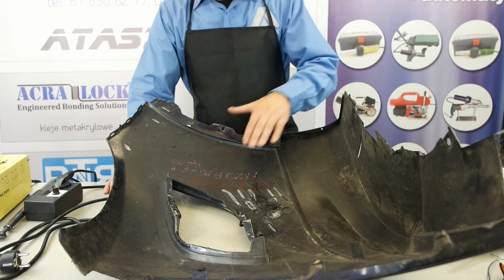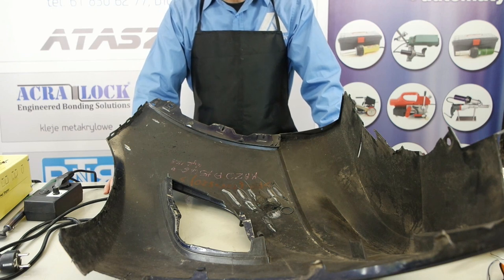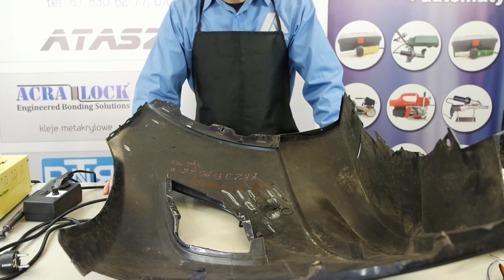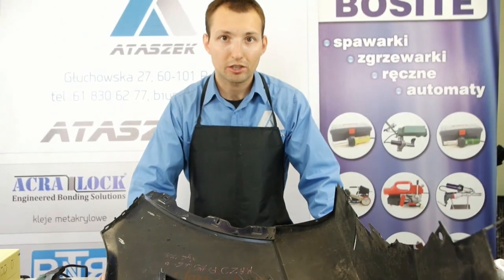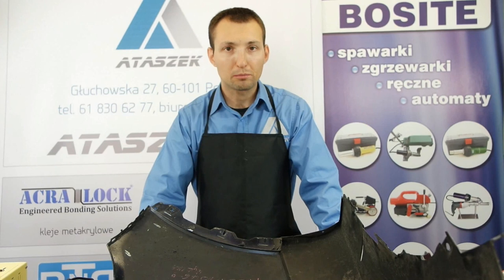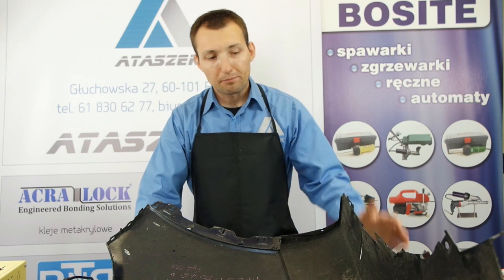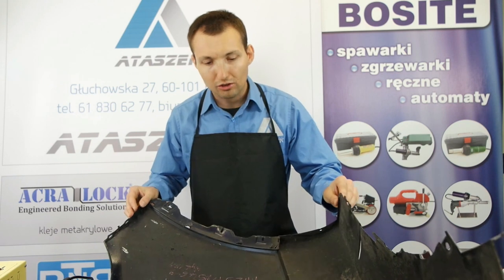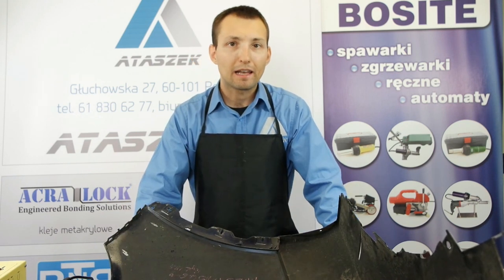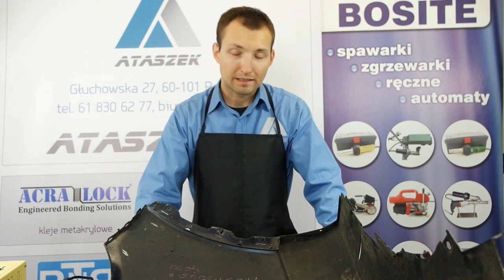Due to the fact that there are 45% of additional fillers like talc or chalk and others, in PP T25 plus S20 there is about 50% of plastic itself, merely 50%. The bumper itself is definitely a strong piece, especially when it comes to flexibility, but the issue is welding. In a moment, I'm going to show you how to fix it.